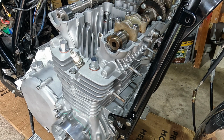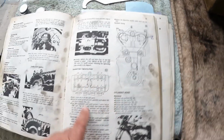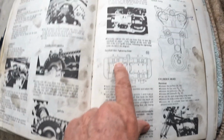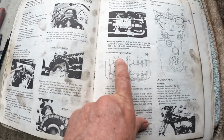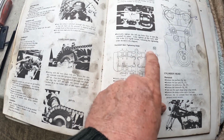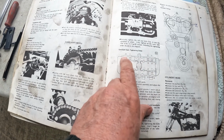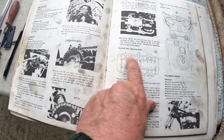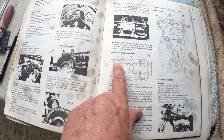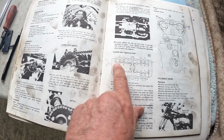So that's the exhaust. Right, the torque settings and the sequence of tightening up. When you look at this camshaft here, which is the outlet cam, I hope this camera's picking it up, 1, 2, 3, 4, 5, 6, 7, 8. But a little bit at a time, so the load as you tighten those caps down is spread across the whole camshaft. That's what I tend to do, and it seems to work quite well. Be careful, as I said earlier, it's very easy to strip one of these threads in the cylinder head.